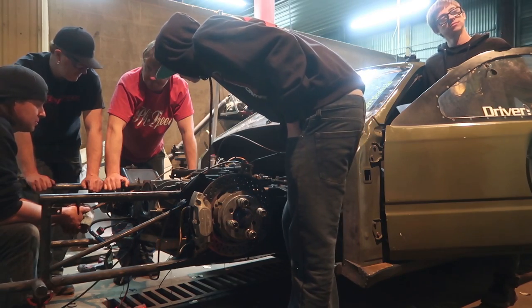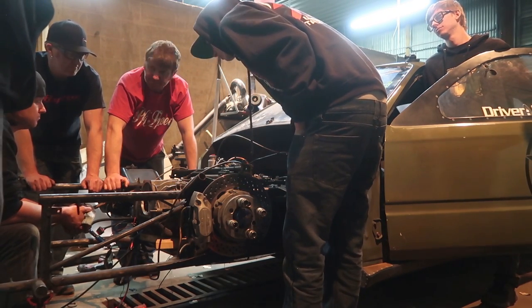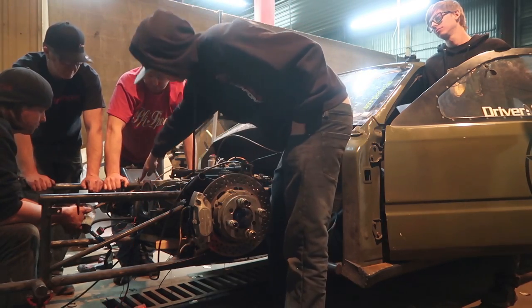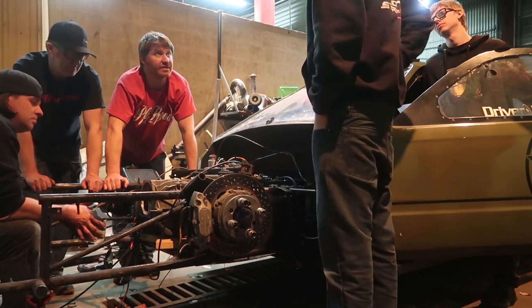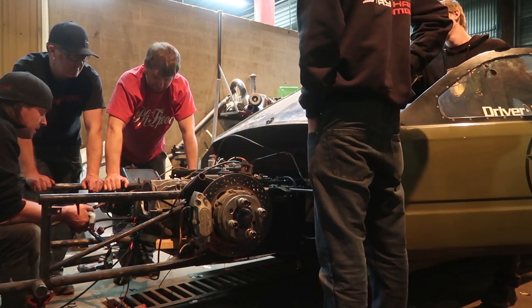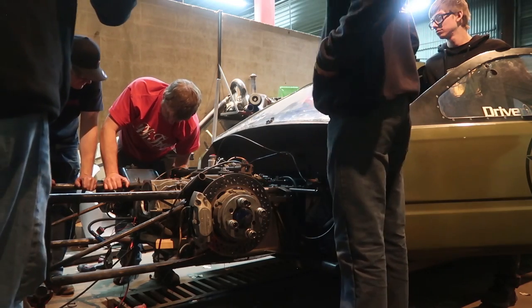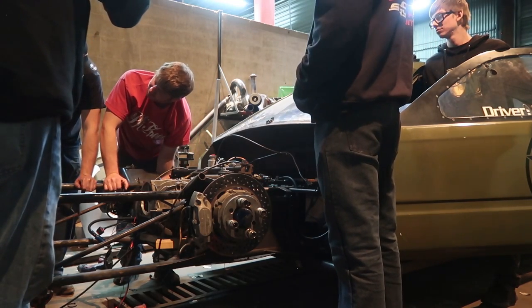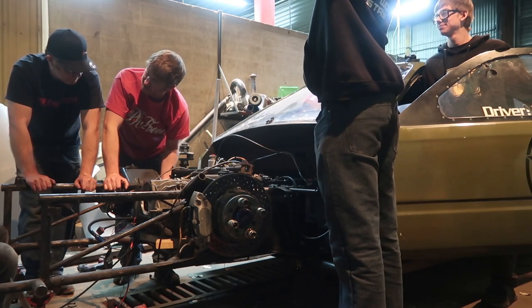If we're going to remount it, we might as well remount where the axles are straight and just redo the steering to where it's good. You have to redo the bar? No, it's right, it's perfect. It'll be fine. Just right on that side of it. And actually, because it's right there, we'll be able to build like a bolt-on strap here. So if it broke, it'll catch it.